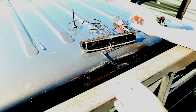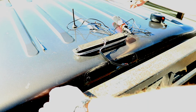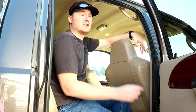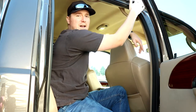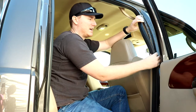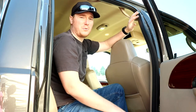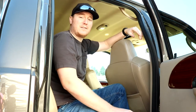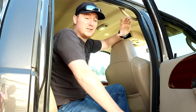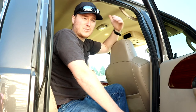That's looking pretty good. So now that I got a good fit here, let's go ahead and go down — we're going to have to drop the headliner so that way we can pull our cable over to the side and bring it down to where we're actually going to hook it into the booster itself. If we're following the original instructions and we had placed the antenna right in front of the door, we would actually be feeding that down into this channel here, and this all just pulls right out. And then you would feed it right in between here all the way down to the bottom, where you'd go back in behind the plastic and either come out under the seat or come up to the front depending on where you're mounting your amplifier. But for what I'm doing, I actually have to remove quite a bit of stuff like the door handles, the top seat belt post, and even the cabin light in the back, which is a lot more involved, and unless you feel comfortable doing stuff like this, I wouldn't go that route — I would just stick with the instructions that they provided.